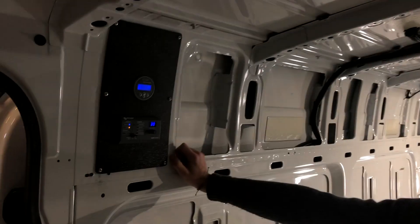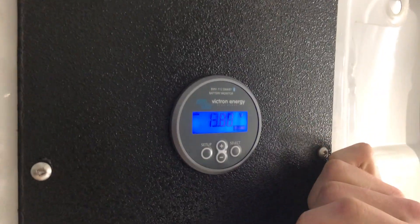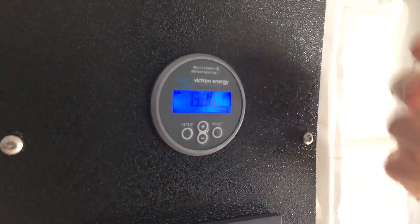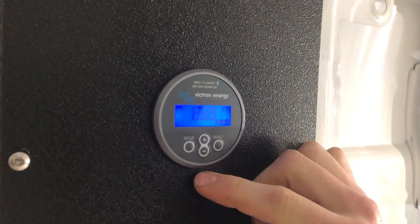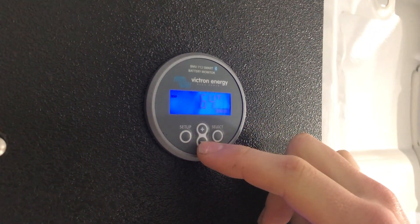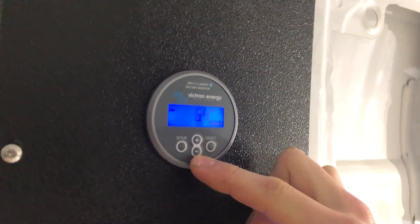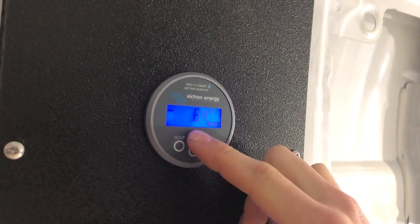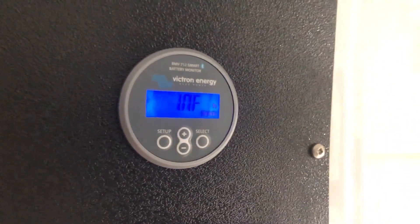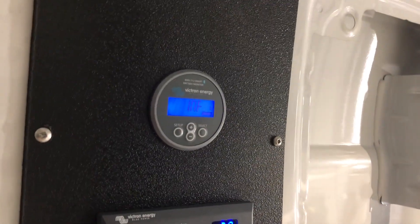Next we explain the monitors — the interface with the rig. Starting with the battery monitor: the first screen shows the voltage of the batteries, sitting at 13.88 volts. The screen is a rotary, cycling between screens with the plus or minus button. Hit plus once and you see battery temperature — we're at 64 degrees Fahrenheit, good to know if you're approaching a cold charge disconnect, though that's unlikely in a van you're living in. Hit plus again and it shows how many hours you can continue running current loads. Because we're charging, it shows infinity — INF.